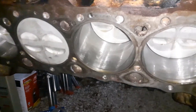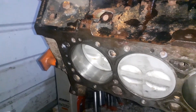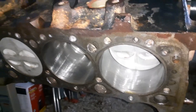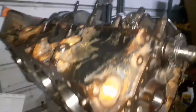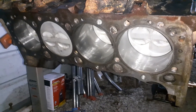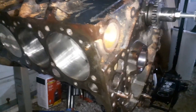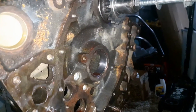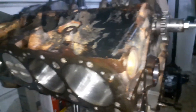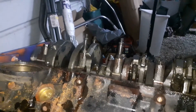I'm going to flip it over and put a bunch of oil on the cylinders and turn it over a little bit so the cylinders stay nice and lubricated and don't rust. That's where we're at — we got the pistons in. We still need the cam and the timing set, need to clean up the heads and put new springs in. Those heads have some surface rust on them. When I get the cam and timing chain set, we'll go ahead and start working on that and make videos of it.